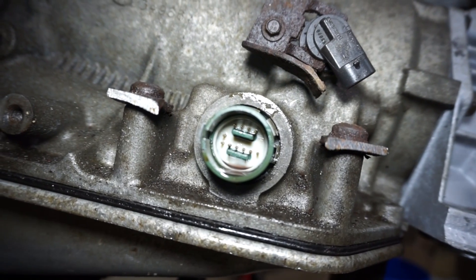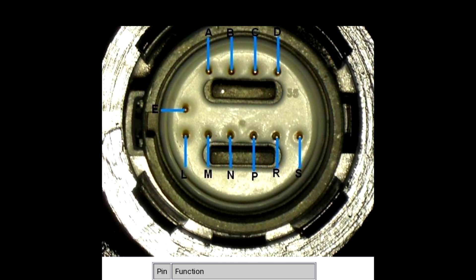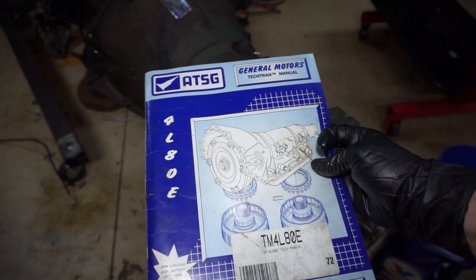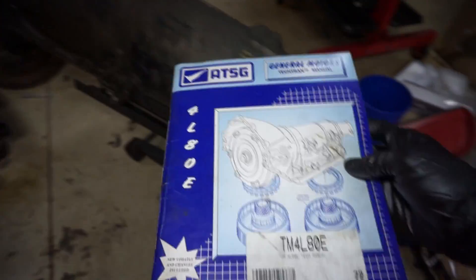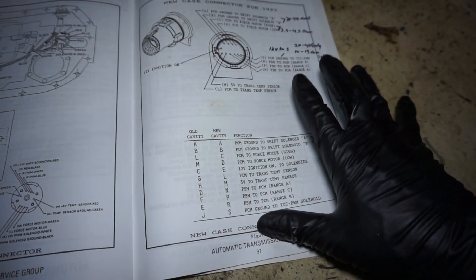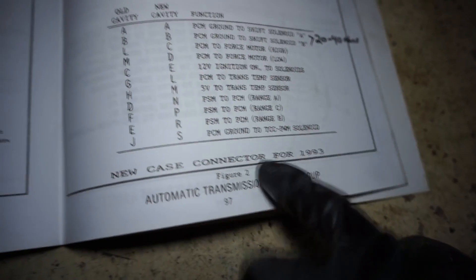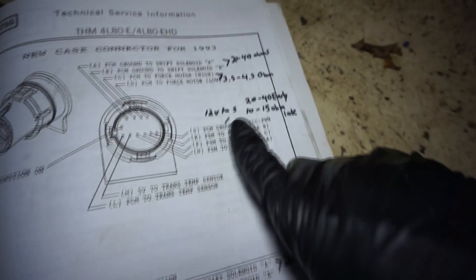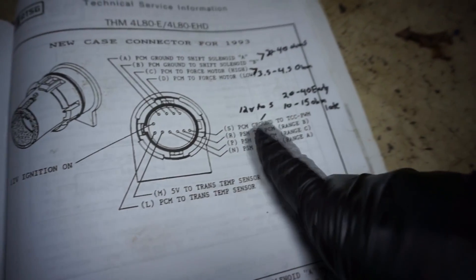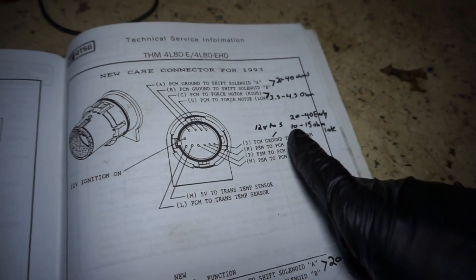I have some specs — I'll show you what they look like and see if everything's okay. This isn't a completely foolproof method, but it's one more step to make sure there isn't a solenoid completely outside the operating range. I have this ATSG manual I bought when I did my first rebuild — I keep it around for reference. The resistance numbers weren't in there but I found them online and wrote them in. There was a wiring change around 93-94, so there's old wiring and new wiring. The screenshot I'll post shows 20-40 ohms for early and 10-15 ohms for late on the torque converter clutch solenoid.